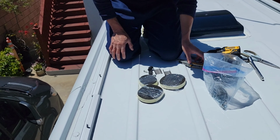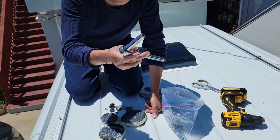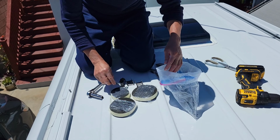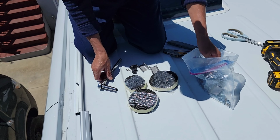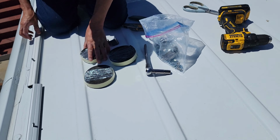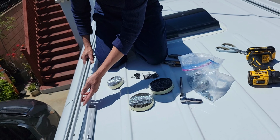So for the equipment and tools you need, basically you don't even need a drill. You will need a 10 millimeter socket like this. This is from the inside. After you insert these screws, you go on from the inside of the van. You put on the lock washer and the flat washer, and the nut, which is 10 millimeter. It came with the weatherproof tape seal here. That's going to go on the bottom of the rail, and when you screw it, it's going to fit really tight, waterproof